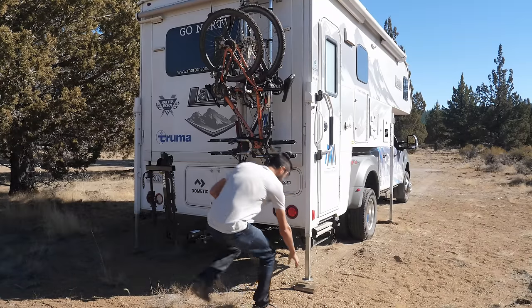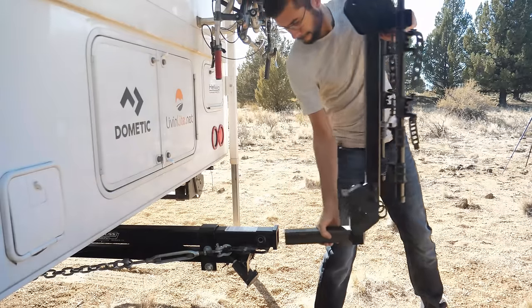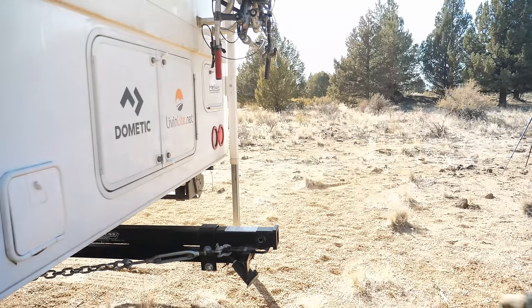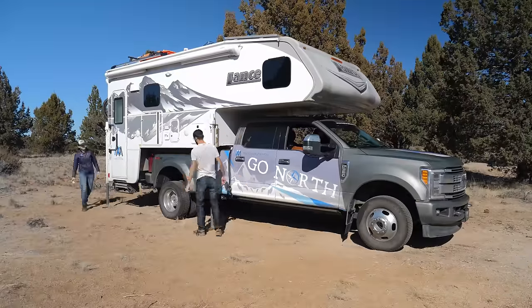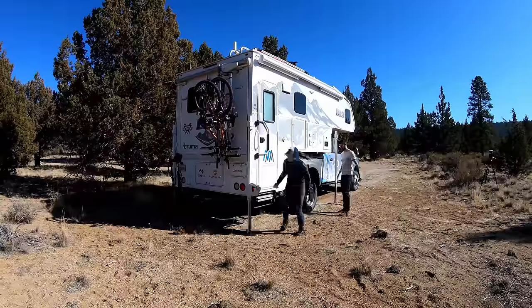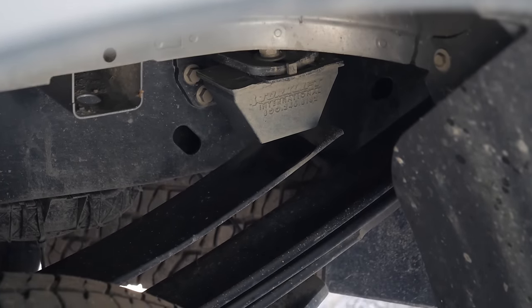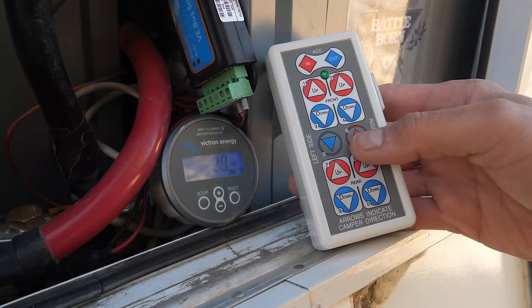Before removing the truck, be sure to disconnect anything else that may obstruct its movement — in our case the bike rack attached to the truck's hitch. Once all the jacks are firmly on the ground, press the all-up button to lift the camper up off the truck. Raise the camper until it lifts up off the suspension and out of the bed of the truck. Electric jacks use a lot of power and some truck campers may need to be plugged in or have the truck running to run the jacks properly — this heavy RV used 550 watts to lift the unit.